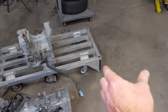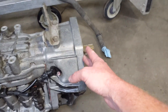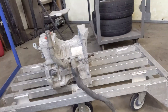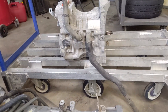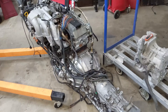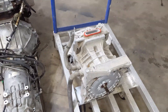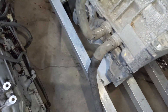The transfer case will stay in the same spot in the vehicle. I'll have the Black Box doubler — about six to eight inches long — and then a drive shaft mated to the output of the Nissan Leaf motor. This thing only weighs like 60 to 70 pounds, whereas the Land Cruiser engine and transmission weigh almost a thousand pounds. The difference is just stark. You can see the three-phase high-current input — it's water-cooled with cooling hoses.